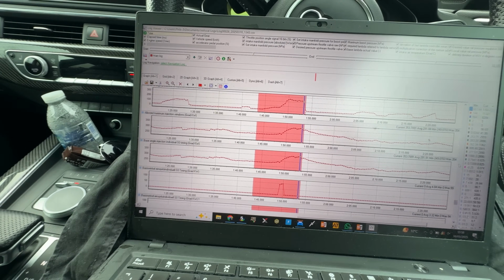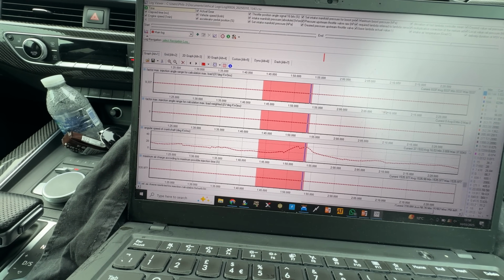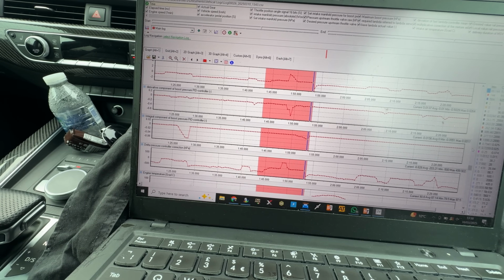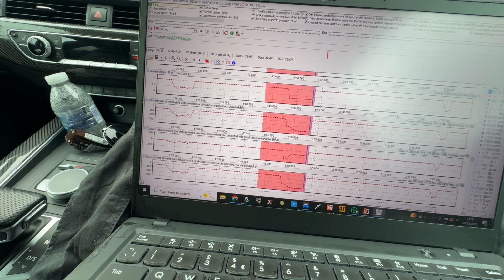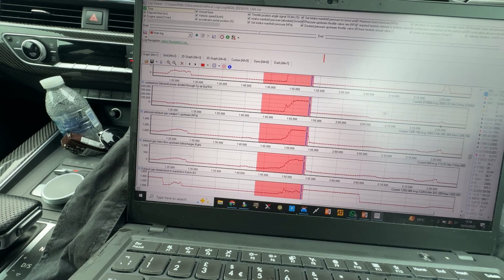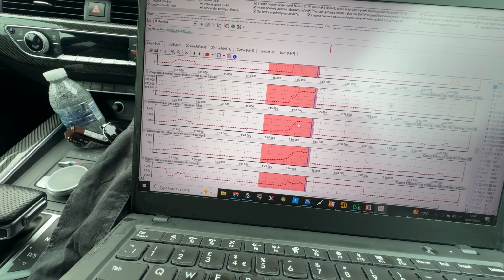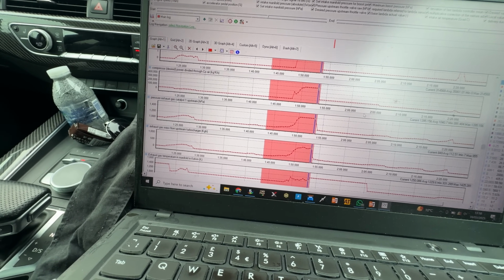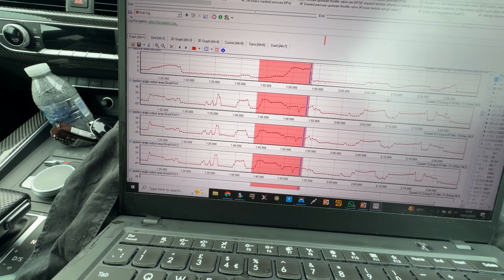Fuel in, base angle injection, that's okay. Camshaft position, all part of the PID. I do have a bit of work to do on the PID, but it's pointless at the minute until I start seeing some returns on what we're actually doing. So we've got pressure exhaust gas cylinder 1 upstream, that's at like 1.4 hPa. So it's something we're going to have to play with, I think.